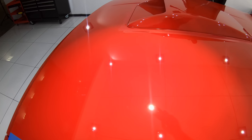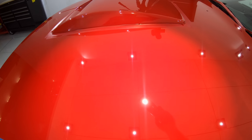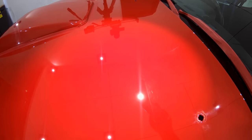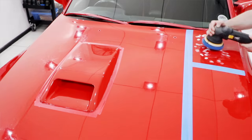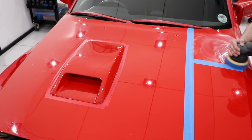So, although I'm close to being happy with the defect leveling ability of this combination, I'm really not too happy with the finish, as I feel it may possibly take two steps to refine it, which is just going to blow out the time that I have available for this job. For a fourth combination, I stuck with CarPro Clear Cut, as I felt it was giving me just enough cut